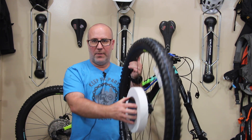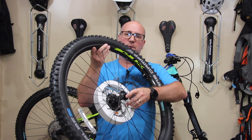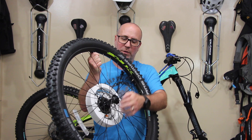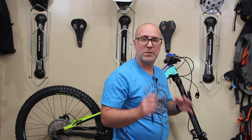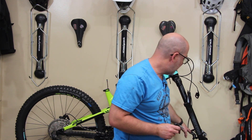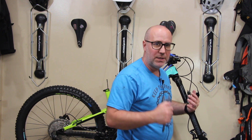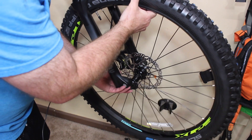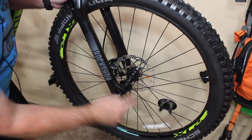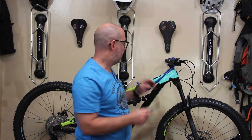Here's an important tip: when you take off the packaging on the front wheel, make sure you don't accidentally lose the cups on the hub — they can pop off. That's why there's a string on there to keep everything in place. So when you take off the packaging, do not accidentally throw away those cups because you really need them. Also, when you put the front wheel on, the front brake caliper has a small plastic shim in it so you don't accidentally push the pistons out. You need to remove that shim in order to put the front wheel on.